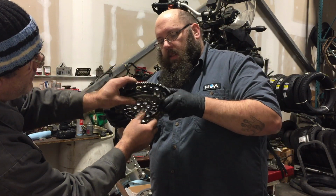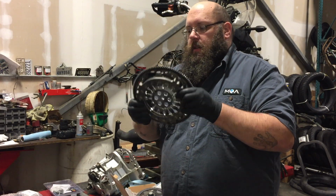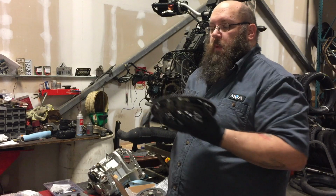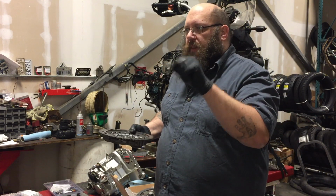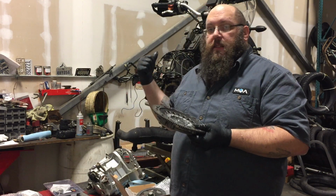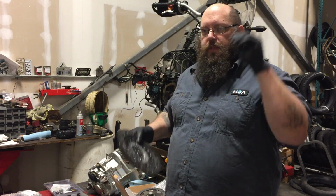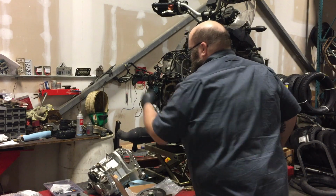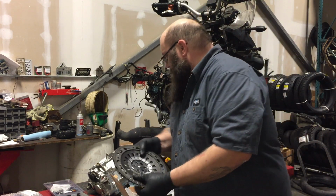They're pinchy. So, and then the friction disc goes in between those two things. Correct. And then when you squeeze your clutch lever, which you do with your left hand, on these bikes they have a hydraulic clutch, so you push fluid into the slave cylinder, which is here-ish. The slave cylinder pushes on the push rod.